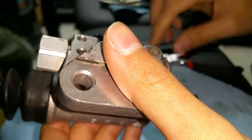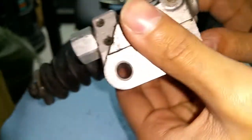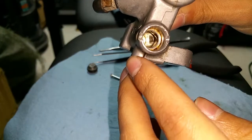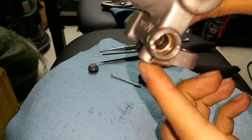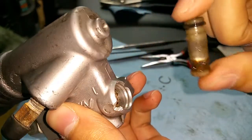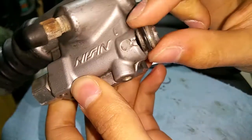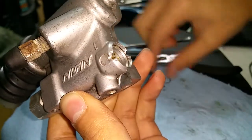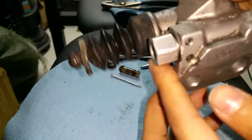Make sure you use penetrating oil so you don't damage the gasket, because you might need to buy a new one. Once I got that all the way out, it looked like a swamp in there so I had to clean it out with a little brake cleaner. After that, just slide this piece out — you'll have a fully functioning slave cylinder. Then slide this back in, lock the locking ring back in there, and that's it. Then it goes right back to your car.